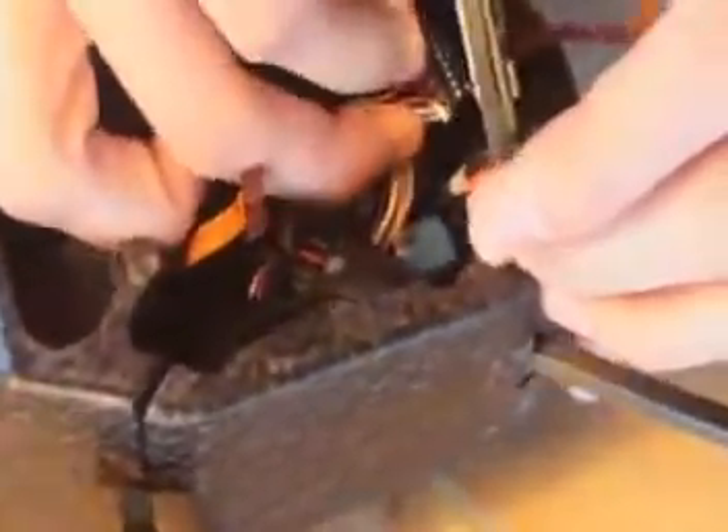Make sure you've got plenty of slack again on those ribbons and connector cords. First do the bigger black one — put that into the bottom larger white connector plug. It's easier to just use your fingers to shove it in there. You've got to support the motherboard with the other hand; try to touch only the edges, glued areas, or plastic plug pieces so you don't get finger oil on the internal parts. Then push in the smaller white connector into the smaller white plug — it's really tiny, especially if you've got fat fingers, but you've got to get it in there.